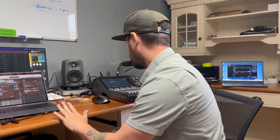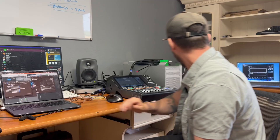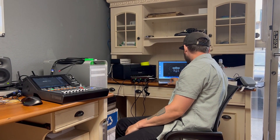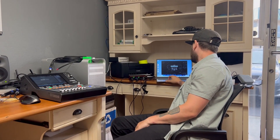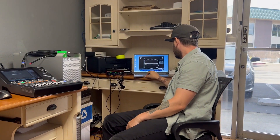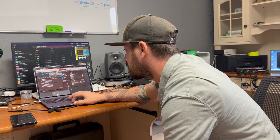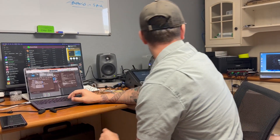In all of our last tests we were running this as a USB interface at 48k. Now we are going to set it to 96k and do the same tests with the same buffer sizes. I have Logic set to match at 96k. Starting with a buffer size of 128 — Logic says 8.9 milliseconds, and Smart has it clocked at 8.35 milliseconds, which is actually better than what Logic is telling us. Changing to a buffer size of 64 — running that test gives us 7 milliseconds. Logic is telling us 7.6 round trip but Smart has it clocked at 7 milliseconds.